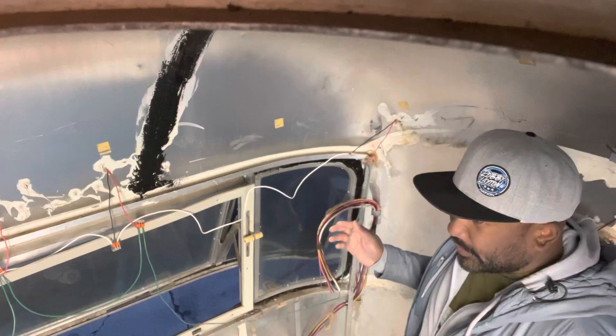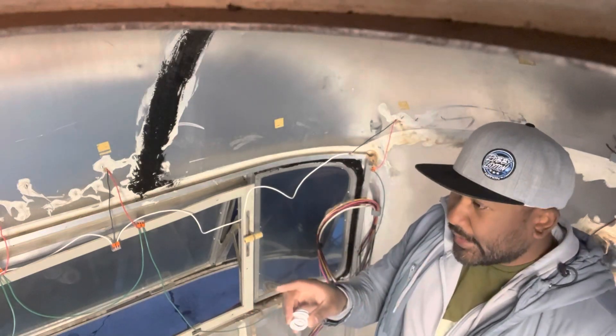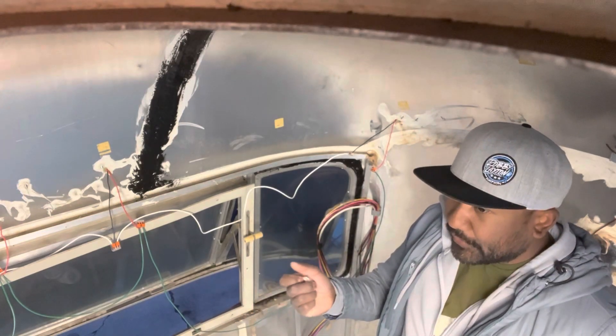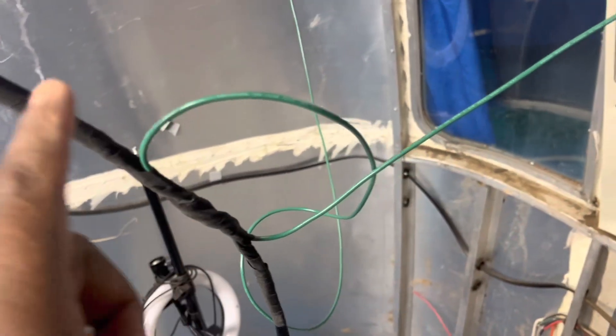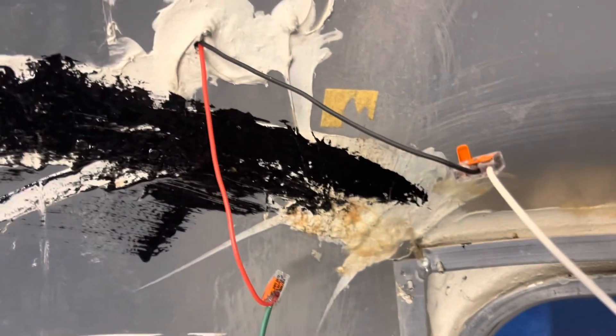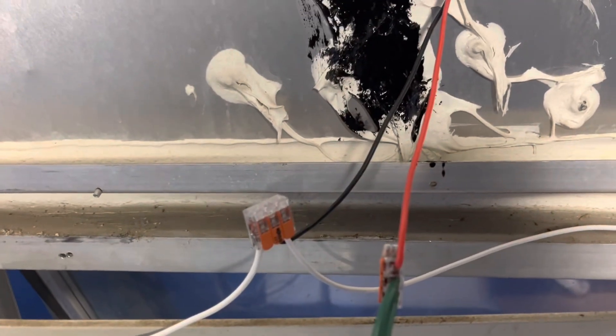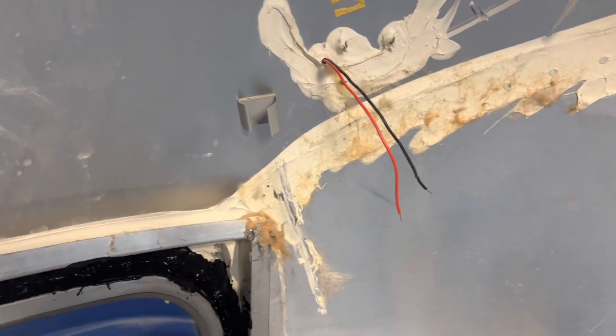I think I have the wiring harness just about done. I have one more length of ground to run, and then I think that is everything to at least be able to test the entire system. I have my power going in — the green is going to all the individual markers. Up here I have power going in through one of those lever connectors. I have a ground and I'm doing it in series: ground for that one, ground to this one, ground to the next one.